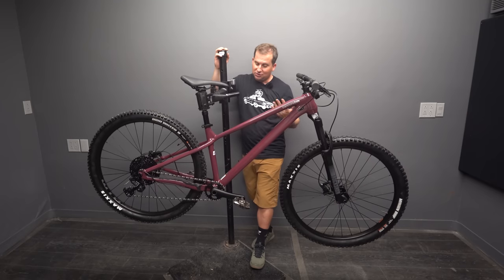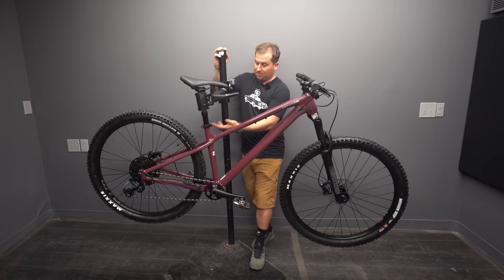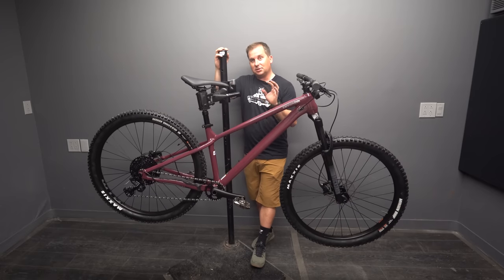I like the Advent X just fine. You can use SRAM on it, you can use Shimano on it, you can use Microshift, but if you ever need to replace that derailleur hanger, you can go into any shop and they're going to have a universal derailleur hanger. It's universal from brand to brand to brand.